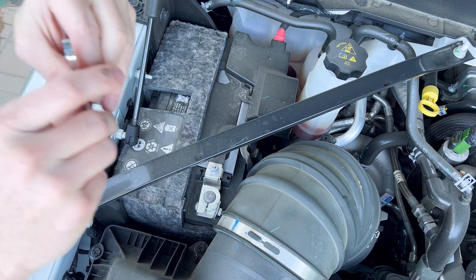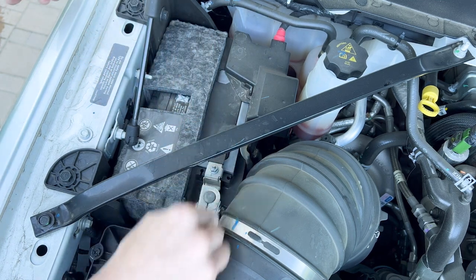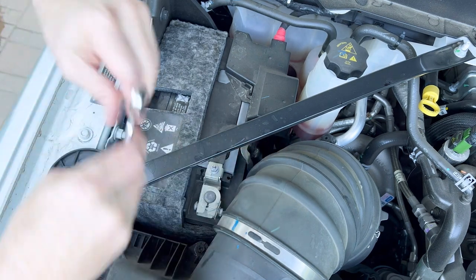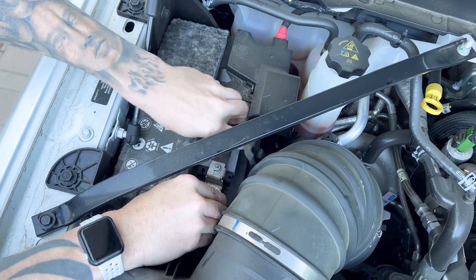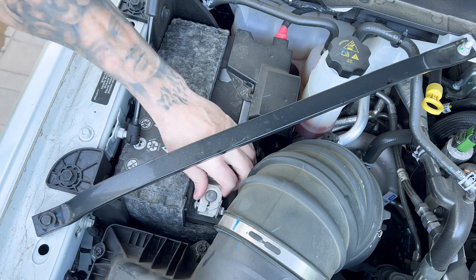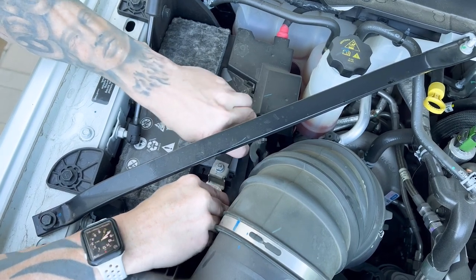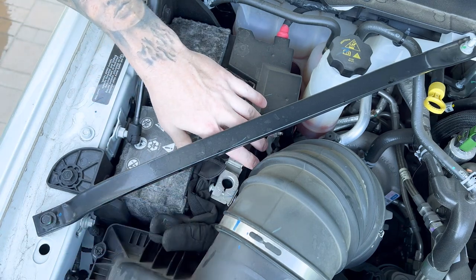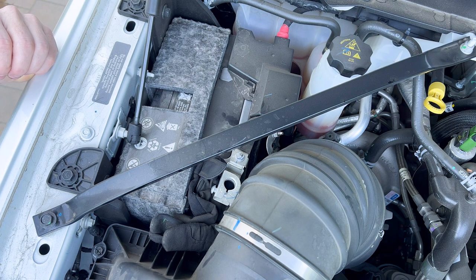On these 2500s you have dual batteries, so come over to the passenger side and do the same thing using a 10mm. These newer cars are a little tighter — just wiggle it a little bit and it should come off. Make sure nothing is touching; we don't want it to reconnect. Now wait the full hour to make sure the juice is gone before disconnecting any other electrical components, then we can get started on the install.